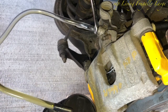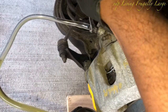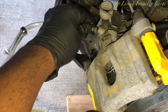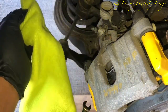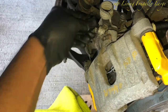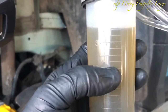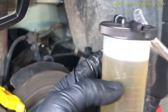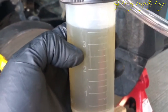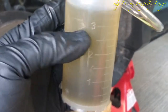That's where we stop. Let's close the brake valve, remove the tubing, wipe the bleeder valve, and put the cover back over it. We are done with this side. The brake fluid was pretty much clear. It started at two and a quarter ounces and we cut it down to three quarter ounces, removing a lot of dirty brake fluid.